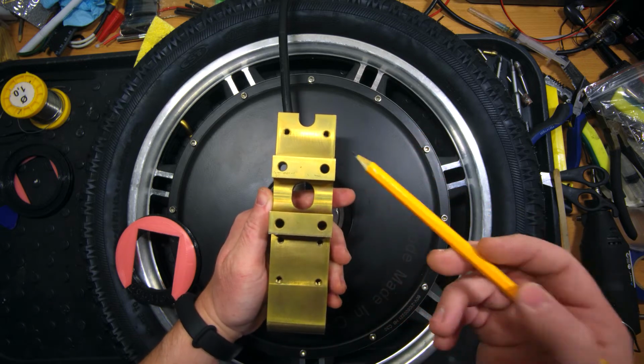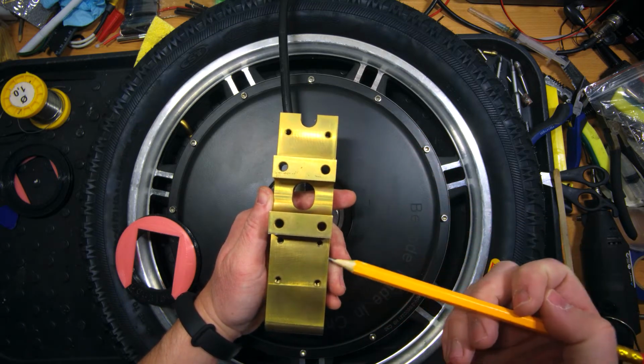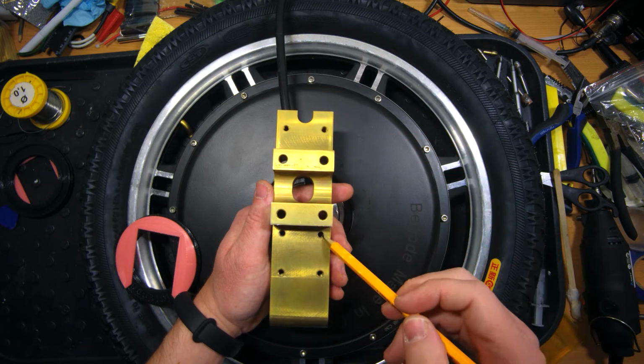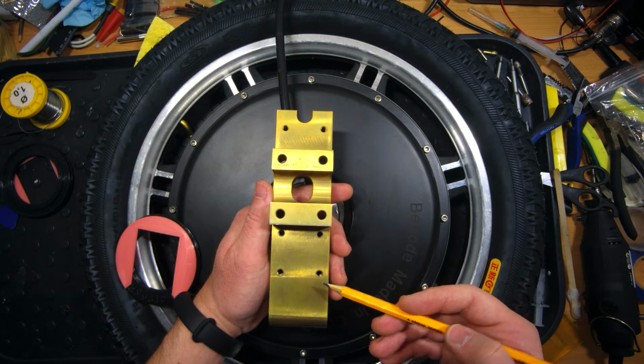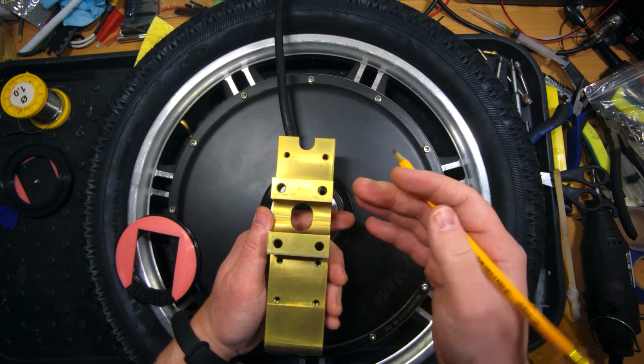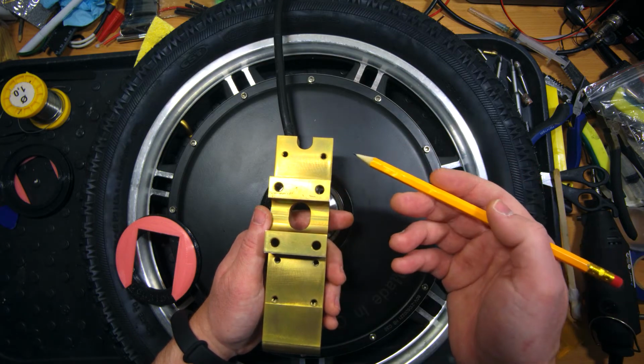By the way, I'd like to show you another life hack which I am using during the wheel's assembly. Cover these bolt holes on the back side of the pedal hangers with sealant to prevent road reagents from getting inside the threads and locking your bolts so that you couldn't even unscrew them.